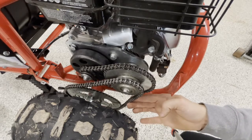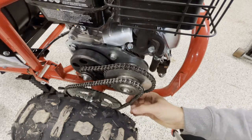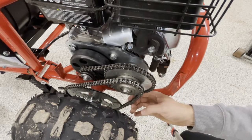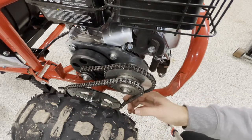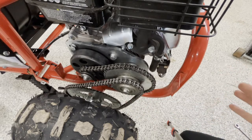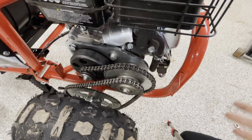This one's actually adjusted really nicely. It's tight enough that it won't come off — you can see there's a little play on both sides — but it's loose enough it won't do any damage by being over-tightened. This is really about where you want it. We've been running this cart for a while and haven't had problems with the chain coming off, so we know this is a good setting. What I'm going to do is loosen this right up for the video just so you can see where it might be in your situation.